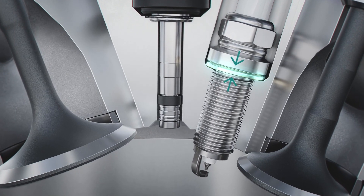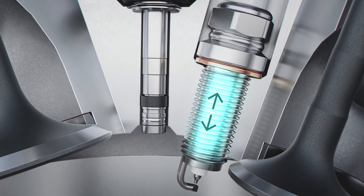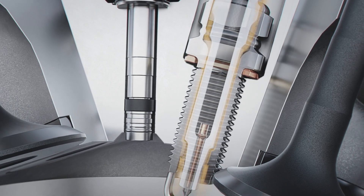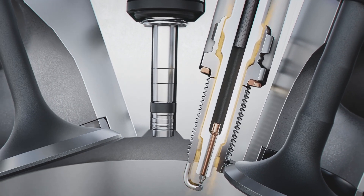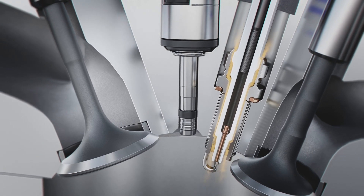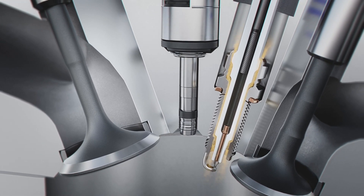The seating is compressed, the housing is stretched, and the crack appears in the thread. The spark plug leaks and combustion gases flow to the outside. This leads to inefficient combustion, spark plug failure, and finally even engine damage.